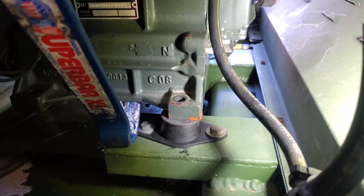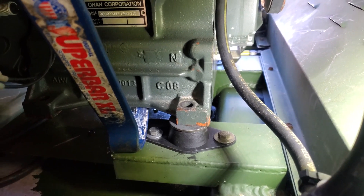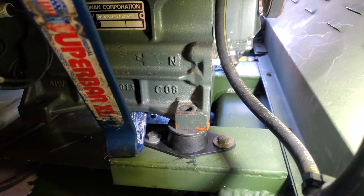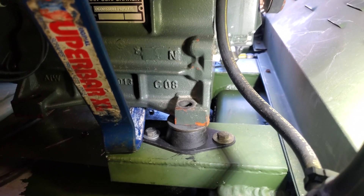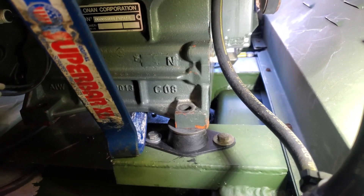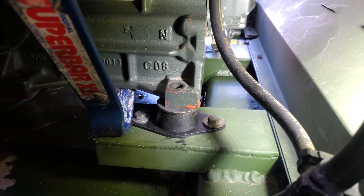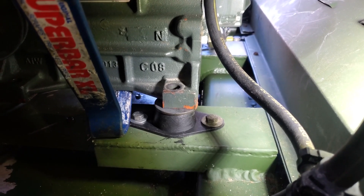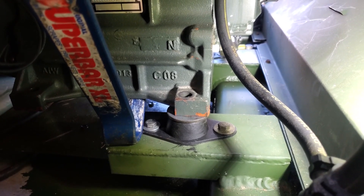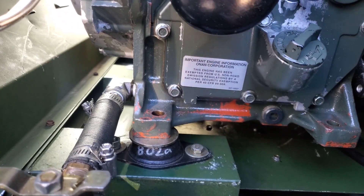When the engine sits on it, this side is not compressing the isolator and therefore is not getting the support that is required. You can't tell in the video, but this side of the generator set — the forward engine side and right side — shakes more than other points on the set. It could be due to this corner being less supported and a torque occurring on the whole engine-generator assembly as it runs. So we're going to stack some washers until the compression measures about even on both sides, then pin it back together and see if that improves vibration.